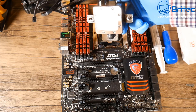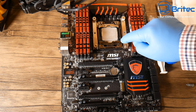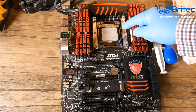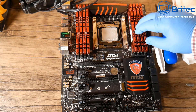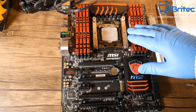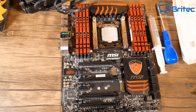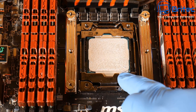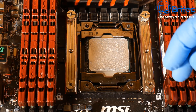Let's pull that off and take a closer look at the results. You don't need to go right up to the edges - that's another bit of misinformation. The CPU is right in the center there and as long as you're covering that, that's all that really matters. You obviously don't want to spill over the edge because if it's conductive compound and there are little tiny electrical components around the edge, they could short or arc - especially with liquid metal used when people delid these CPUs. You can see the pattern there - those little tiny gaps are what they're calling air pockets where it's been compressed down, and honestly in all my years I've never heard so much hogwash.